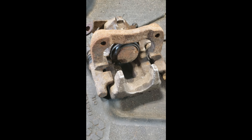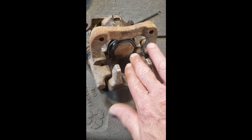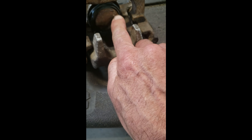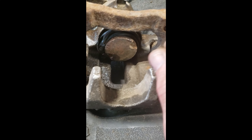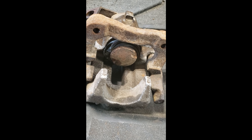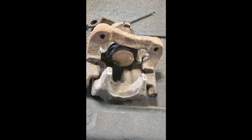This is a rear brake caliper from a Type 4 Jetta, which I believe is 1999 to 2004. I've seen this on British cars before but never on a German car — apparently it's pretty common, but it's the first German car I've owned. It has a handbrake mechanism here that rotates as a lever and advances a screw inside, which pushes the piston out. As you use the handbrake, it compensates for pad wear and adjusts the piston position.